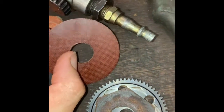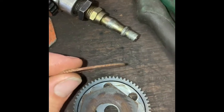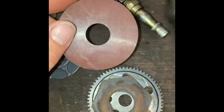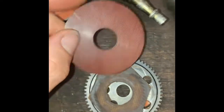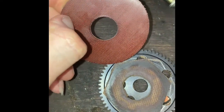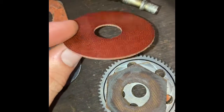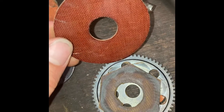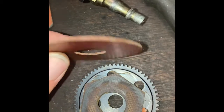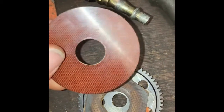I really wanted to use some sort of brake pad. I was going to get a 1.5mm carbon sheet and see if carbon fiber would work, and yeah, that's going to be able to handle the heat well, but it's going to be somewhat laminated, which means it's not going to grip as well. I think the carbon would cope with the heat a lot better, but what you really need is some sort of organic sintered carbon ceramic type material.